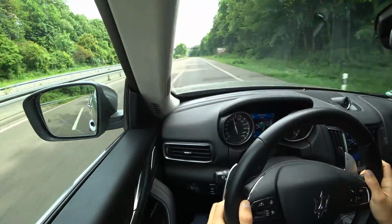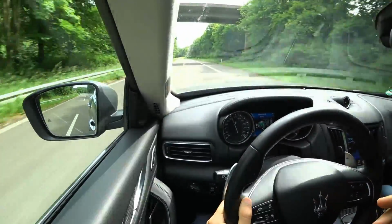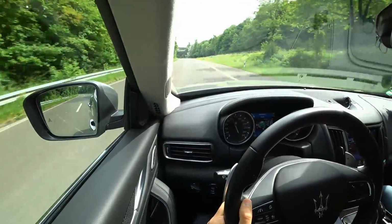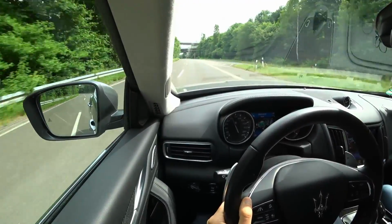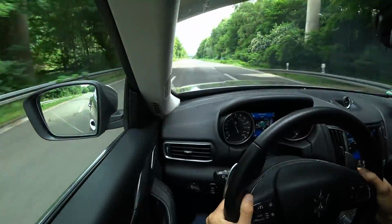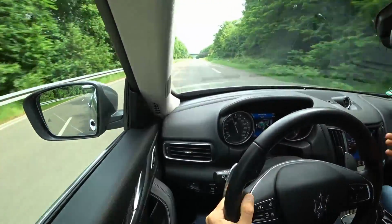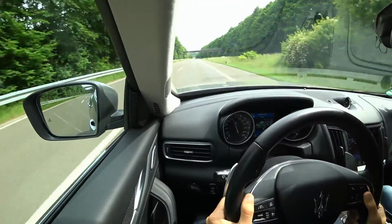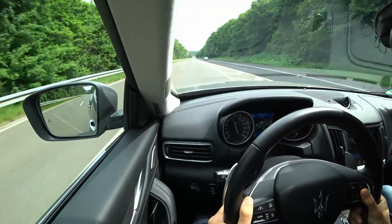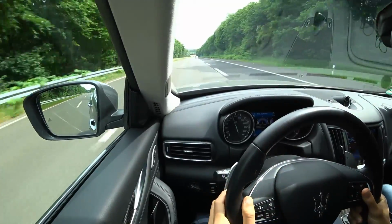That's really interesting. Maybe it's a difference when you start from standstill, or if you're already at very high speed. Because at higher speeds, when the vehicle is getting pushed backwards, you also get more grip at the rear, just by physics. Therefore, rear-wheel driven cars can have more horsepower than front-wheel driven cars, because sometimes the front axle just lifts when acceleration is happening, and then the wheels just start spinning. So the surprising finding here is that the all-wheel drive is obviously not distributing too much to the front, at least when you're already at higher speeds. Maybe it rather happens when you have some more spontaneous reactions, for example.